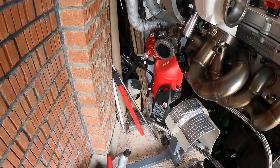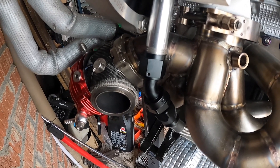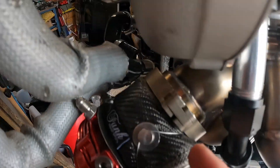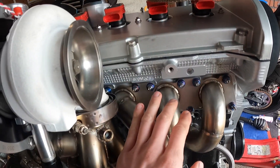I want to make sure I keep heat away from the drain, because my drain is going to live actually fairly close to the exhaust, as you can see around here. Obviously this has got this little blanket on. I've got heat sleeving that's going to go over, but it's still quite close, so I'm going to stop some heat coming off of it.